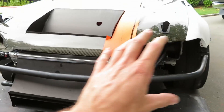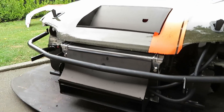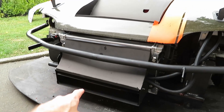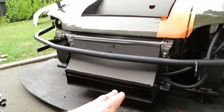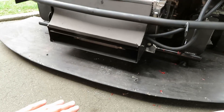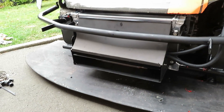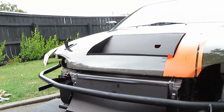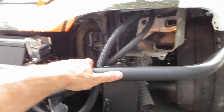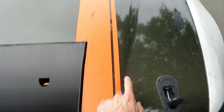Given I'm trying to seal the whole front off, basically the air goes in through the radiator intake, hits the front of the bumper, and goes around the side or goes underneath the splitter. I've got some concern about engine bay temperatures and the lack of airflow. Worst case, I think I'll put some vents either side of the ducting — that's no drama.